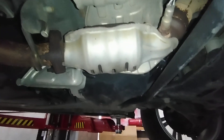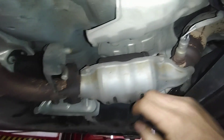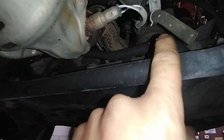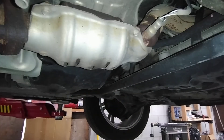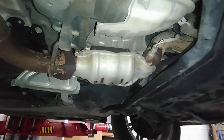If you listen when I tap on this, you'll hear pieces of the catalytic converter inside of it. There shouldn't be any rattling sounds inside of there. That's because the front catalytic converter is coming apart inside, and it's sending pieces down into this one, which is restricting the exhaust flow and giving you the misfires on all cylinders because it can't flow the exhaust out efficiently.